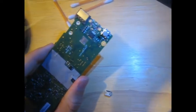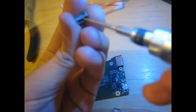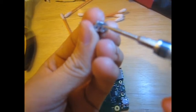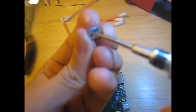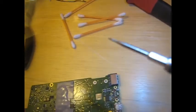I got the USB port off — here it is. Here's the old USB port. The inside was busted, so I couldn't plug anything in. Right here there are pins — those don't actually get soldered on; they just kind of push against the board to make a contact. So it doesn't actually have to be micro-soldered, and that's what makes this possible by hand.